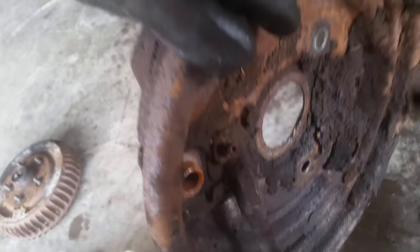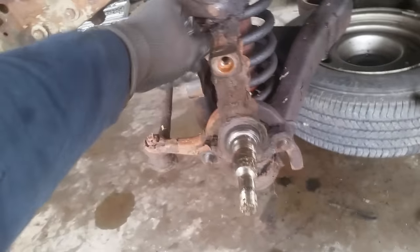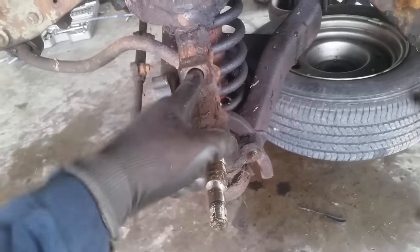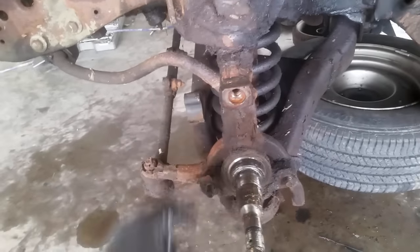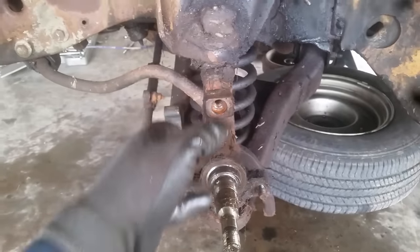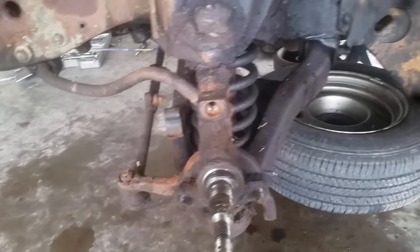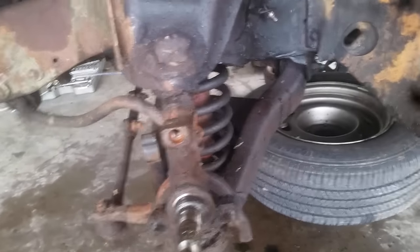See that rusty piece right there that's kind of clean? That's the piece that goes into here on a Pontiac or a Buick and Oldsmobile. Chevy will have half-inch bolts right here and 5/8 bolts here, whereas in this case on this old Buick, that's a half-inch dash 20, and then those are 7/16ths. So you have the option of buying a different steering arm off of a Chevelle and a different spindle — the pair of spindles is $130 from Speedway, but there are other places that sell them.